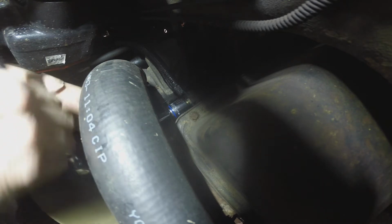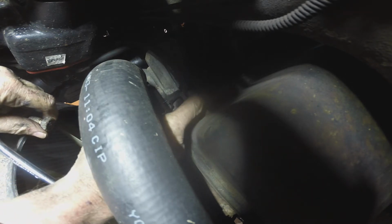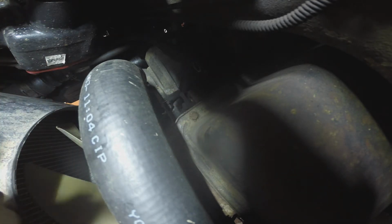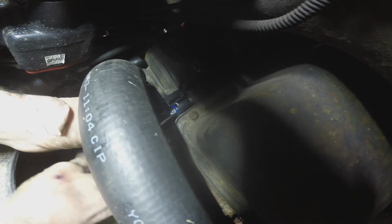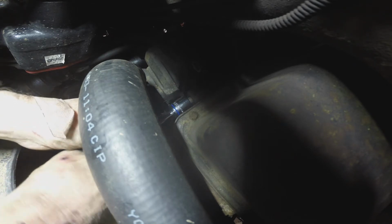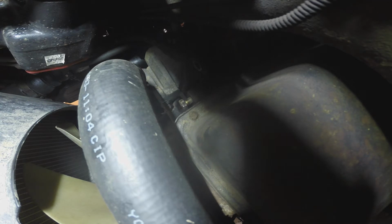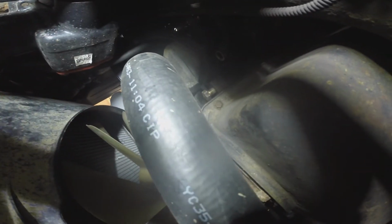That's oily, but there's no oil leak. It's because I slopped some ATF or power steering ATF down here. So that's what looks like an oil leak is probably me spilling stuff. I mean, this thing never drips anything on the driveway, so I know it's not leaking. Plus I treat everything under here with linseed oil and bar and chain oil, a mixture. I brush everything to keep the rust at bay. So I don't want any rust under here. If you see something that looks real oily, it's one of those two things. Either I spilled something or it's just what I'm painting on with my paintbrush.